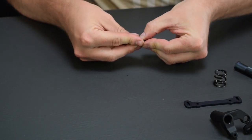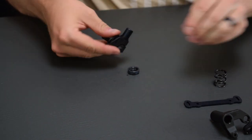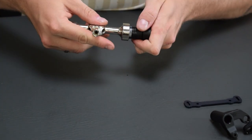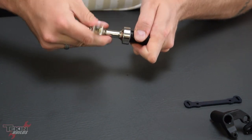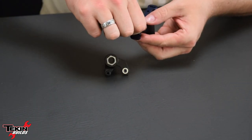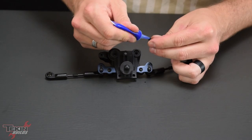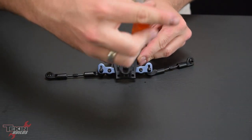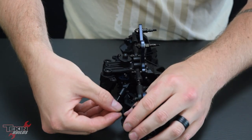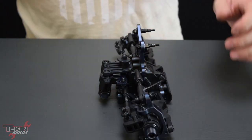The first part of our steering rack is our servo saver, and it does exactly what it says — it saves your servo. At factory settings, this servo saver is allowed to take heavy hits and this spring takes a lot of that shock load off of your servo gear train. It's definitely going to keep your servo running in optimal condition a lot longer. The steering system on the Tecno is a dual bell crank design — it rides on bearings, it's extremely smooth and highly tunable. Everything from Ackerman, which changes the aggressiveness of the steering, to bump steer with the provided washers. We're going with factory settings: four washers. And that wraps up our front end.